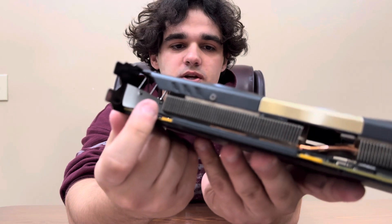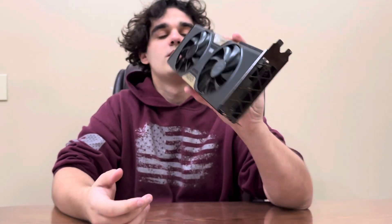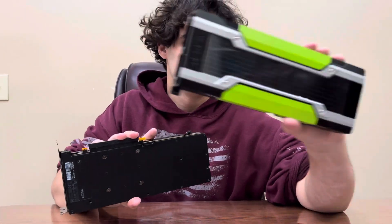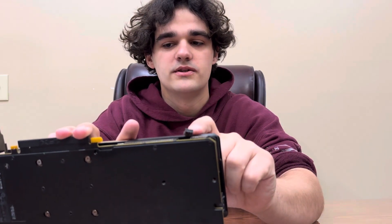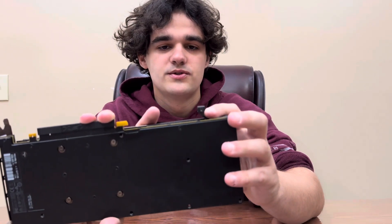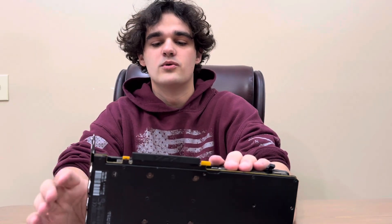Additionally, there has to be a way to attach the front piece, so I've bent a little piece of aluminum to go back here to screw into. One more thing: you've got to power the fans, and there's nowhere to plug the fan connector into on the Tesla card, so they make adapters you can buy on eBay, Amazon, or AliExpress to convert it to a regular fan header that you can plug into your motherboard.